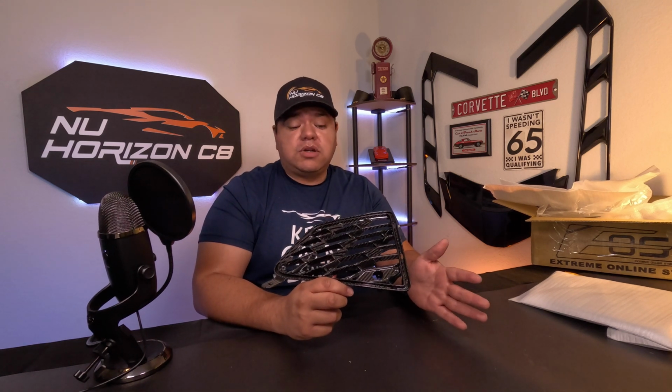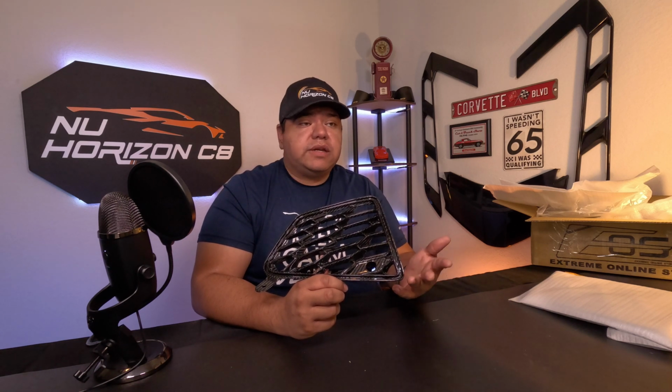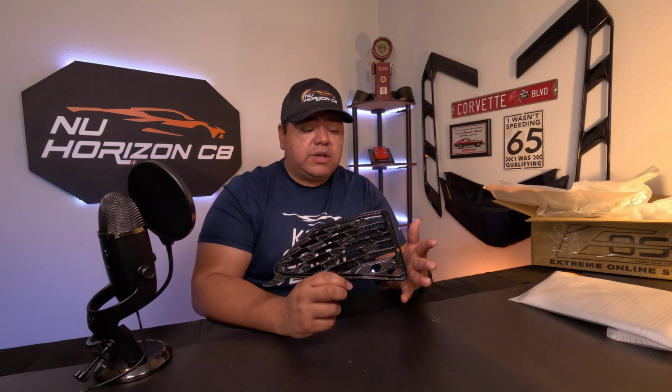Now, one of the things, like I said in all my different videos, especially when I'm talking about carbon fiber, you definitely want to ceramic coat these just to make sure that you get that extra layer of protection, especially from the elements. Depending on the complexity of the part and how evenly and thick the clear coat is, you want that extra layer of protection to help prevent yellowing on these carbon fiber pieces. If you're wondering what kind of ceramic coat you should use, I use Adam's graphene ceramic coating. It's my coating of choice. I'm not sponsored by them. This is just what I use.